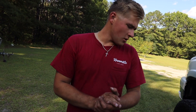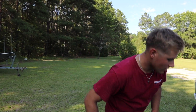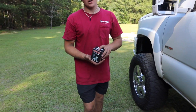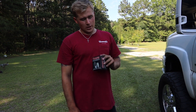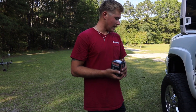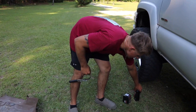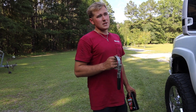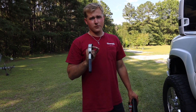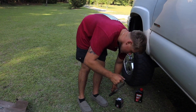Let me show you the basic tools and items you need to get this filter out. What you're going to need is a replacement filter — the best filter to use is the Allison OEM one, but we went ahead and got this one at O'Reilly's. You'll also need a filter wrench and some transmission fluid, as it may be a little low, under the midway between half and full range once you check it again.